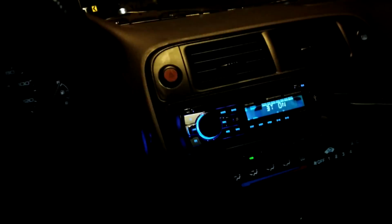So I'm on the road giving a little test drive. Heat is okay. The temperature on the gauge is right where it should be. The heat, like I said, is just okay. But I don't know, maybe there are a couple air bubbles left in there to burp out. I do overfill the coolant reservoir just to make sure if there are any more air bubbles, they'll work their way out on their own,